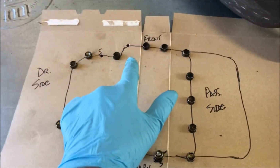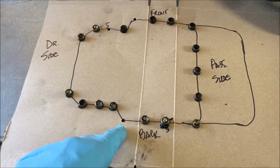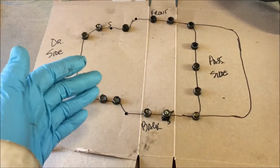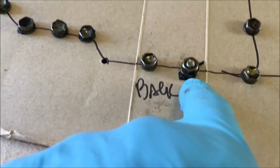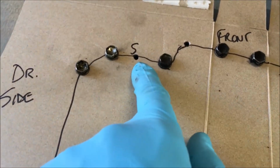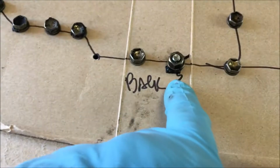I have all the bolts out except 2, that one and that one. I'm taking them last. I'm going to take the front one first toward the front of the engine, this one last, just in case the pan comes down. That stud right there, the stud and the nut came out. That one up there, just the nut did, so I'll have to resolve that in a bit.